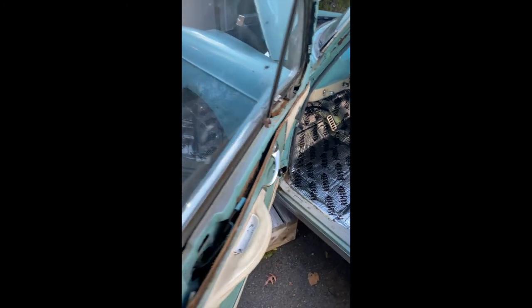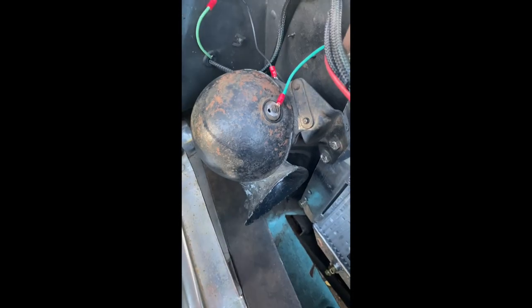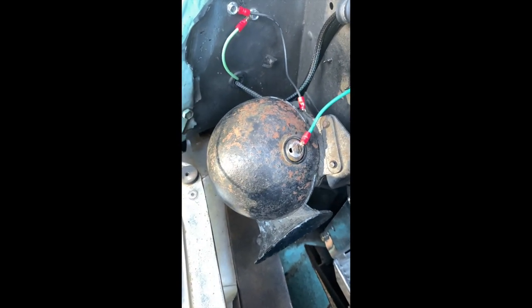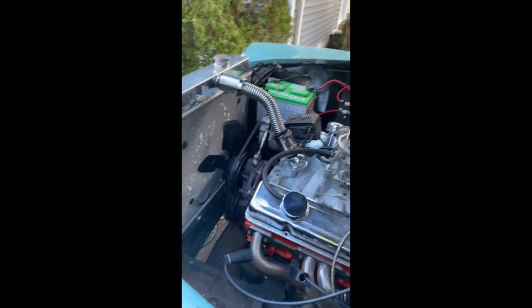As it turns out, the second horn wasn't broken — it needed to be cleaned. Talking with a few people online, I popped the little side tabs off and found it just needed a ground connection fix. Because the radiator body itself is aluminum, the ground didn't work right. A quick fashioned ground to the frame and the results speak for themselves.